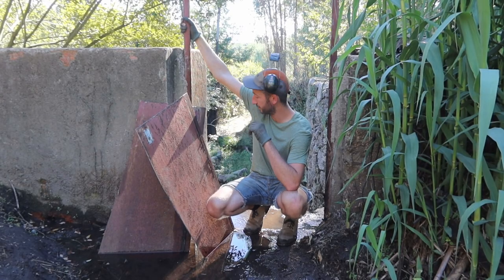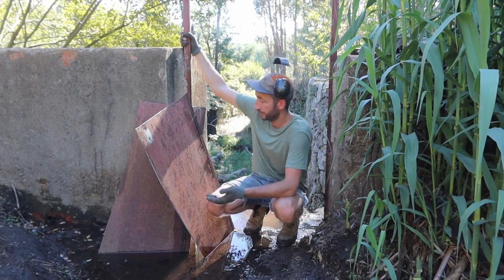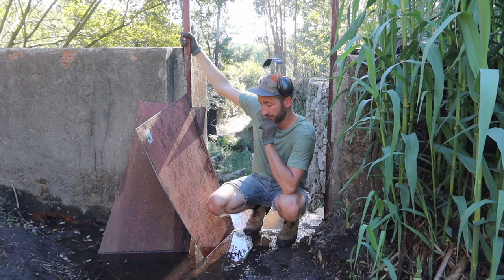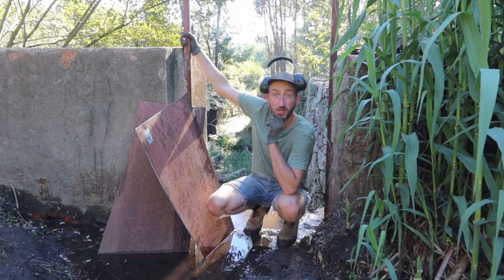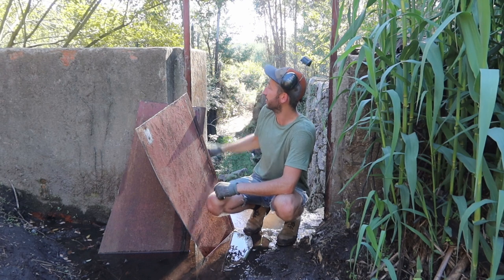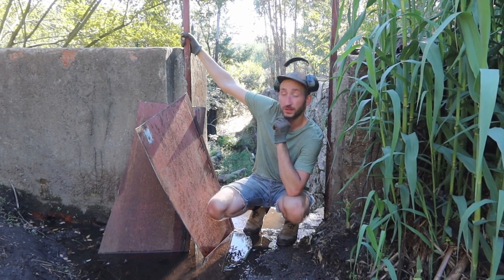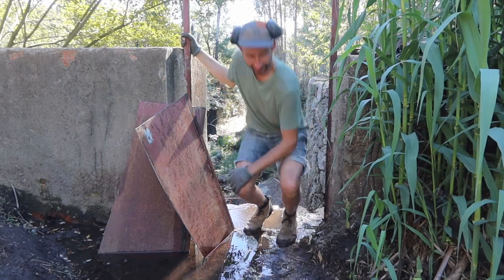Right, so the door is finally out. It was mainly rusty here at the bottom, actually. Pretty stuck still. But now we have this broken door, but I figured maybe we just clean it up and weld it back together so we can slide it in. So as we have the grinder here, I'm gonna clean up these edges and I'm gonna bring this to the workspace and then fix it up, hopefully.